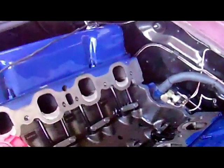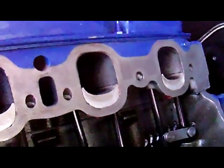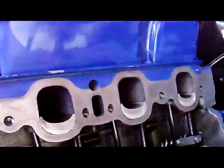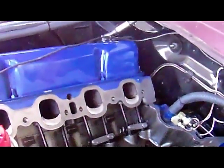Here are the heads. If you look in there, you can see those Roush intake wedges. Those reduce the port size by about 30%. We really don't lose much CFM, but it's a pretty big boost in velocity, which really boosts the low end torque and flattens out the torque curve. So I'm matching the manifold to those so I don't have that turbulence-inducing restriction in there.